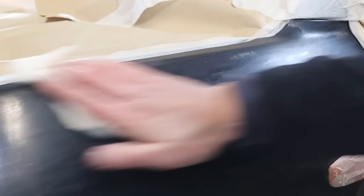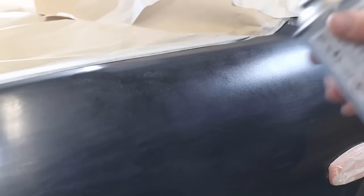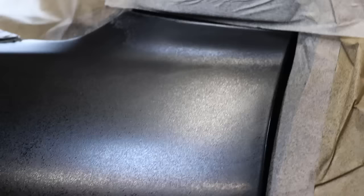Here I'm giving a quick rub with a tack rag before I put the base coat on. Just a light coat of the base coat — I don't want to go too far down the fender. There is a chance that the shade could be different, so I'm just getting a heavy enough coat to cover the areas where the clear coat was peeling.